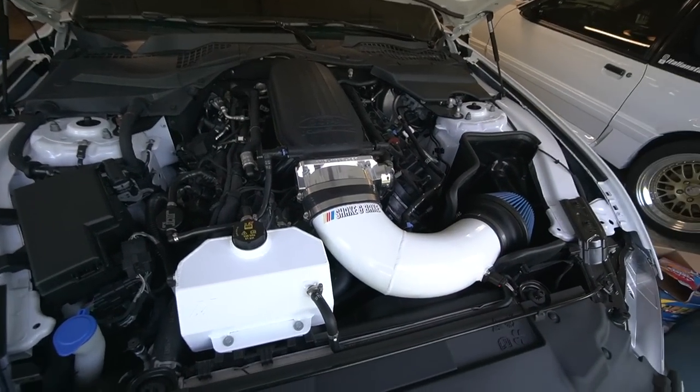I want you guys to comment right now because I've been looking at getting another car for the channel. I'm really feeling a C6 Corvette Z06 - probably an early 2000s or 2007-2008. I believe it's 2008 or 2009 when it comes with the Tremec TR6060, but if I get that car I'll be doing an all-motor build. The C6 heads, cam, E85 makes about 650 to the wheel, and the T56 can hold about 700-750 to the wheels, so I'd somewhat be in a safe spot. Please drop a comment on what car you guys want to see - also find me on Instagram at ItalianSign410.